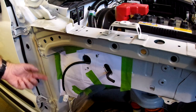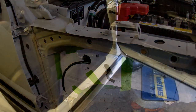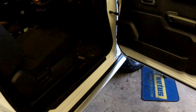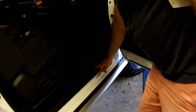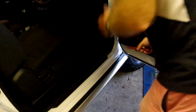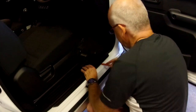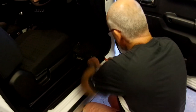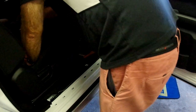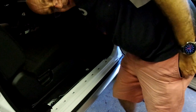According to the instructions, we have to remove the plastic panel inside the door — I presume that's because this is where it's going to drill through. In a similar way to what you'd have seen in the reversing camera and the rear speaker videos, we've now got to remove this piece of plastic here and that one here. It's a bit dark to video, but it's a very simple process — all you need is a trim tool just to start to lift the trim. Then we have to do the same with the front bit, but there is a little twist connector right up at the top of the front that I'll have to do.